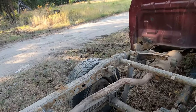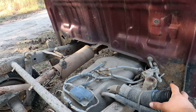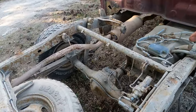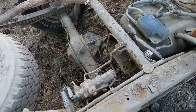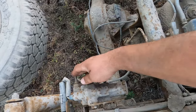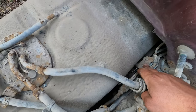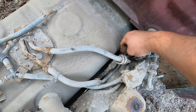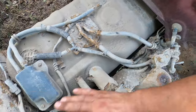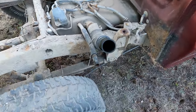I'm going to power wash and clean everything, then cap those two lines and get everything ready for brake line removal. The leaking brake line will get replaced, and probably the one running under the cab as well — we'll put a new one in, clean everything up, and service it. Now we're at the perfect time to do it.